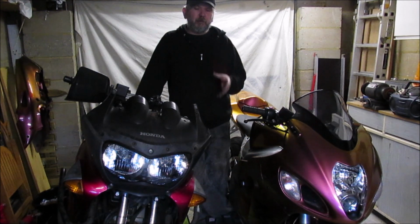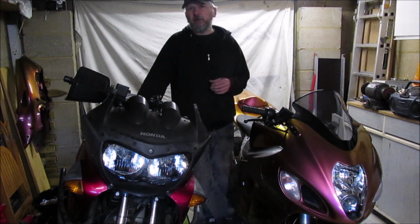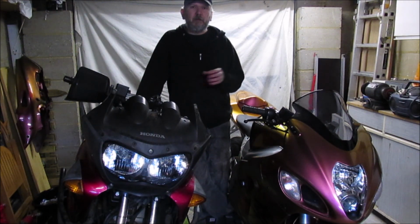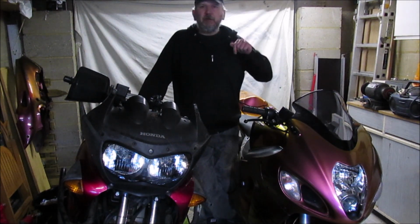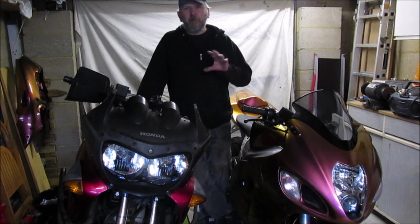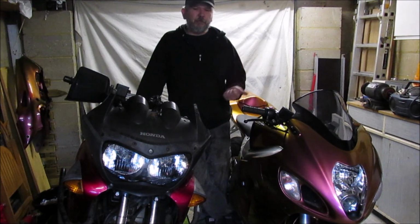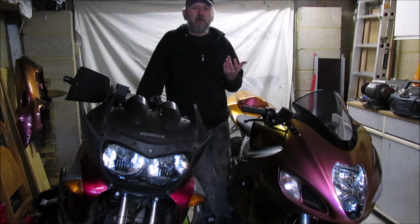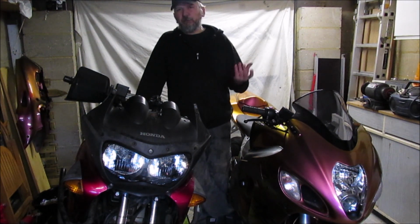We briefly covered part of it when we were in lockdown. It was like a lockdown mini project. It's the XS750 triple cylinder head. I'll put a link in the description to when we did the rocker cover. That was just a basic clean up, refurbish and paint. We're actually going to do the cylinder head, which involves the valves, using the valve tool. Clean up all the valves, deburr, have a look at the actual ports, try and clean them out as well, and basically just refurbish the head.